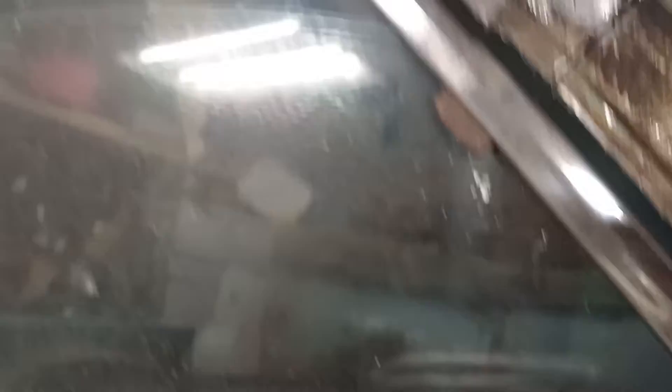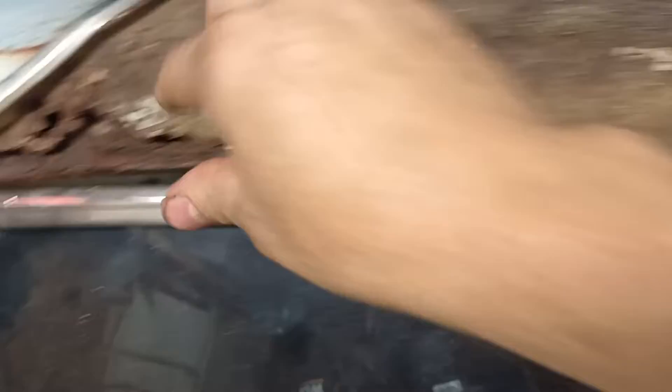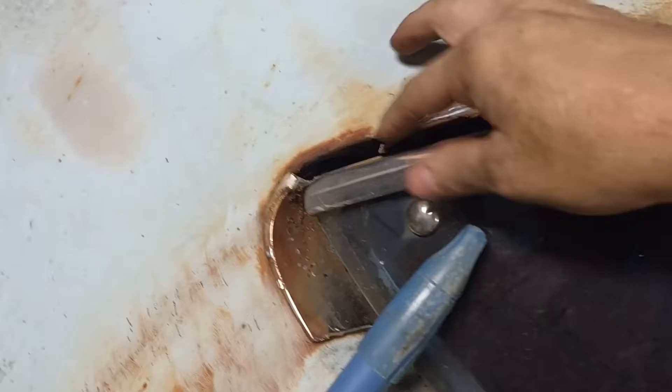I just took that piece of metal and dropped it, but look at that — I just tore a piece of it out. The roof skin is bad, but I've probably seen worse. The problem with this roof is all the structural damage. The drip rails are all completely rusted off all the way down to the body, and it's rusted into the actual quarter panel — the whole edge of the quarter panel is completely rotted.